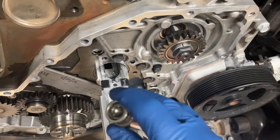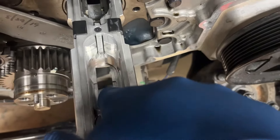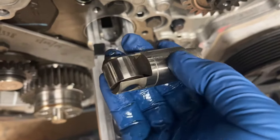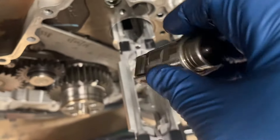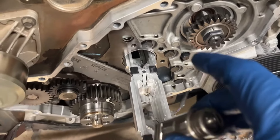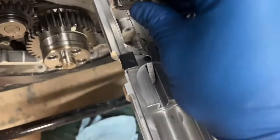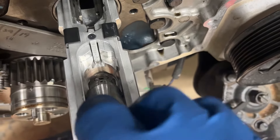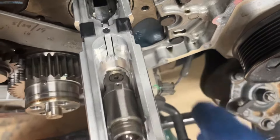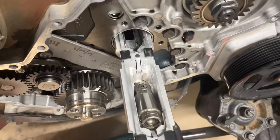There are two notches where the boxed end of the lifter sits into. The keyway needs to be towards the intake side of the engine. So what you do for exhaust — which is what you do first — is put the boxed end in the divot, then simply lay it down. Do this for every single one, making sure the keyway is on the correct side.